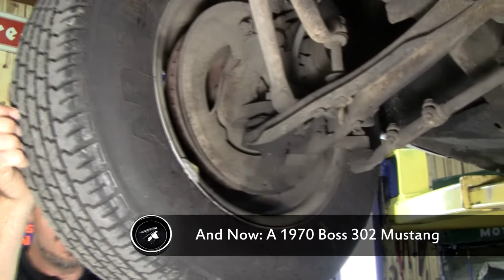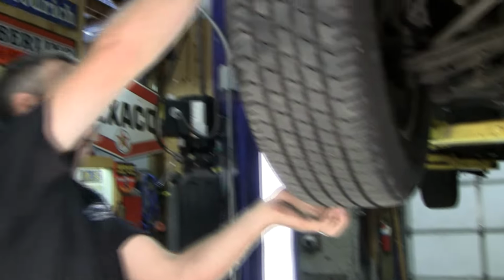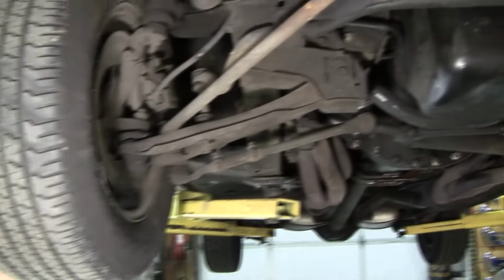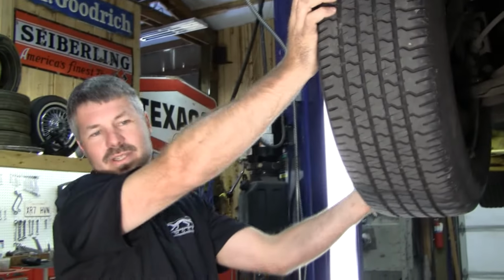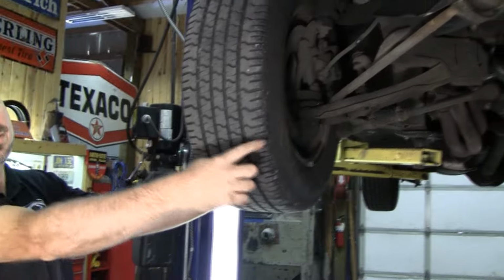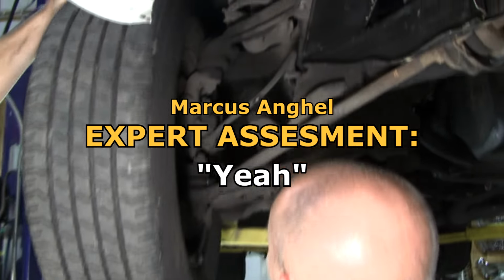What do you see, Andrew? What's that idler arm doing? Oh. Going up and down? Yep. So there's your piggy right there. What's that? Idler arm. If I go 12 o'clock and 6 o'clock, I might feel some ball joint looseness there. What do you see there, Marcus? You poke under there and see what you see on that upper ball joint. Yeah. So upper ball joints.